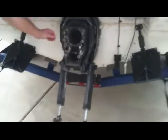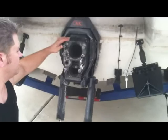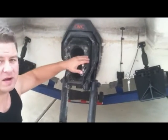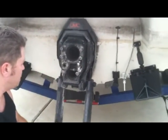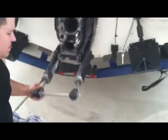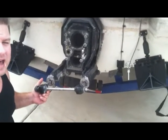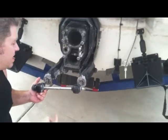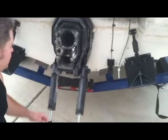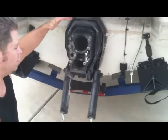Here you can see the gimbal housing and the bell housing with everything removed. These are the six nuts back on here — I just keep them here to keep it organized. So this is what it'll look like once it comes off. Trim cylinders once you take this out — remember, there won't be anything supporting the drive, so have a 2x4 or something like that for it to sit on. You can move these out of the way, and then once these six nuts come off, your drive will pull free.